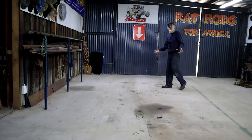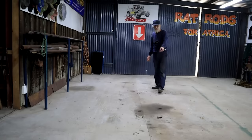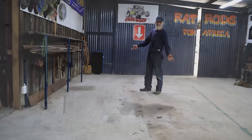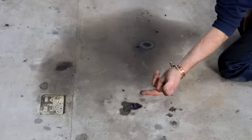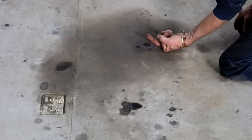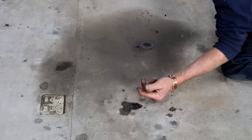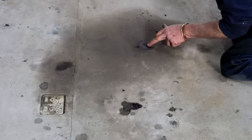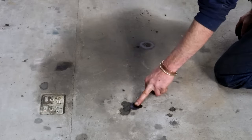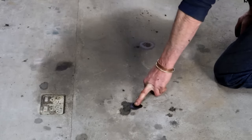It's a very rare occasion for this bay to be empty — there's nearly always something standing here. As you can see on the floor, many cars have been sweating horsepower here over many years. That wet spot is the contribution from my little Nissan. I actually know this one is from the oil pump — it's got a nut on the bottom and that copper washer needs replacement. And I think this one is from that tappet cover leak. So we should be able to solve this quickly. It's not a massive leak, just a very slow sweat over time. We'll sort it out down the line.